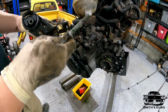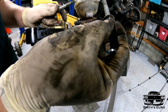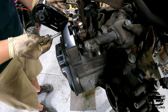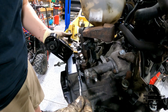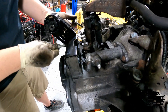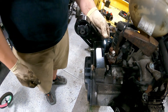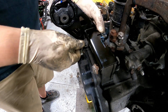We have the mount put on, but unfortunately they didn't give me any bolts so I have two of my own. This one has a stud on it because you need it for the ground wire off the battery. Set this one bolt and they have this little spacer you've got to fish in with it — fish it in like that. And then this is going to be the clutch cable bracket — I think it goes this way, so that's how I'm going to put it in for now.